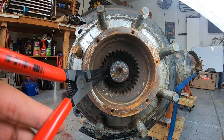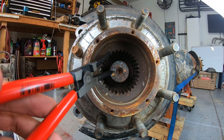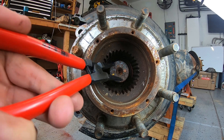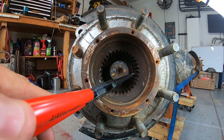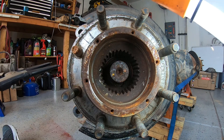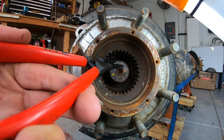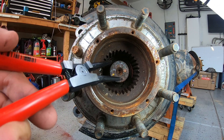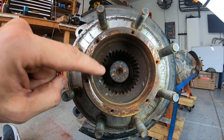Let's get back to it. This one down inside there, as you can see, has some dirt and grime from a gasket that was failing and the hub consequently failing. This piece right here that I'm tapping on — this is the end of your axle shaft, your 35-spline outer that locks to the hub. Out here is your hub assembly. These splines will lock to the axle shaft splines with your locking hub. Right at the top on this particular side, this snap ring could really be anywhere in there. Way back deep in there you might see two little holes to put the ends of these pliers in, and when you squeeze them it opens the snap ring and you can usually get it out. Sometimes it fights with you a little bit, but we're going to try our luck. Both of these have to come out — this side as well as the other.